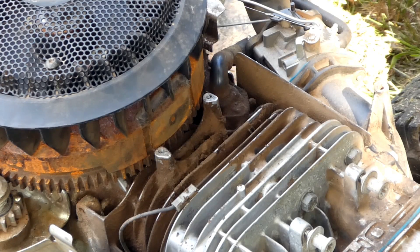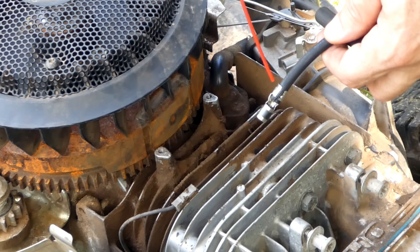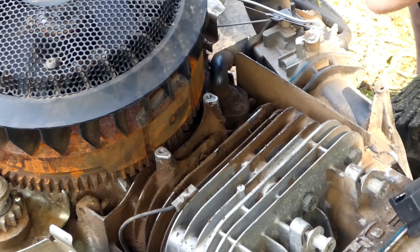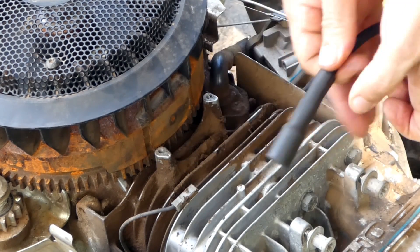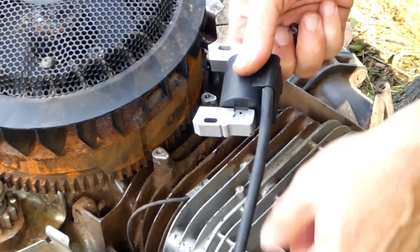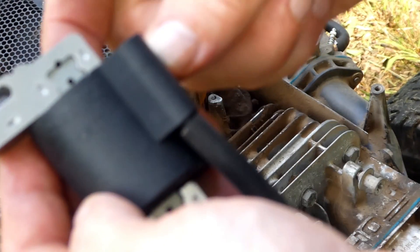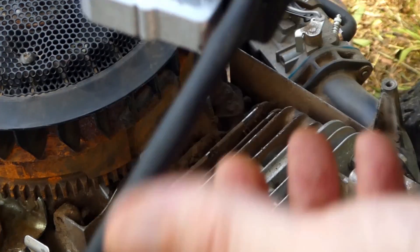Because of the wide variety of boots that come with these engines, your coil may not come with the boot. If it doesn't, you can just take your old boot off. I'm going to use a little electric contact lube to help the boot go on a little bit easier, but you can use just about anything. It just helps to get the boot on there — put it all the way in like so. And we can put our new coil on. Pay attention to the instructions on the outside of the coil as you'll see here — this side will be down facing the cylinder and this side will be out. You can also tell that from the direction of the spark plug wire.